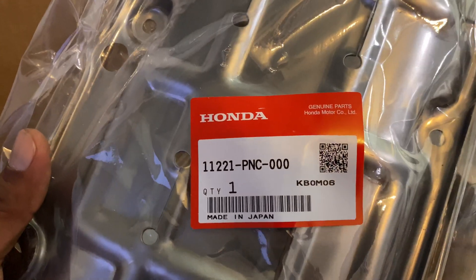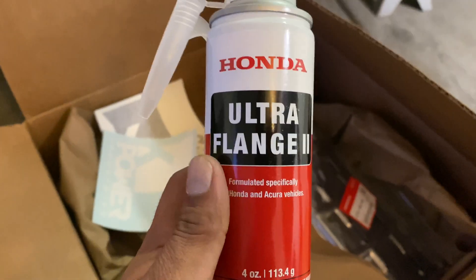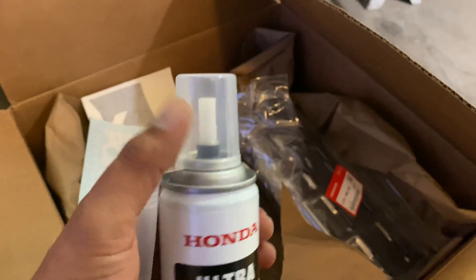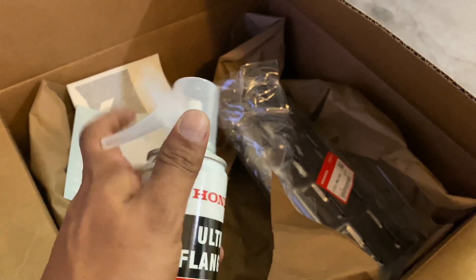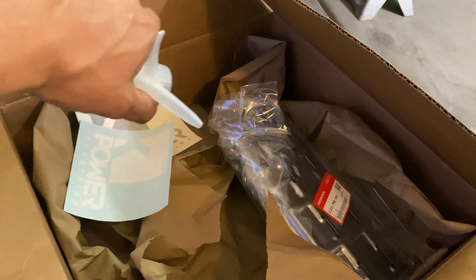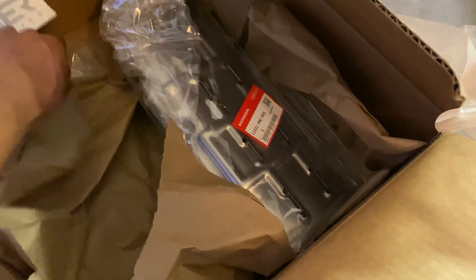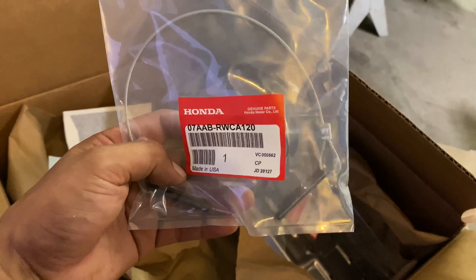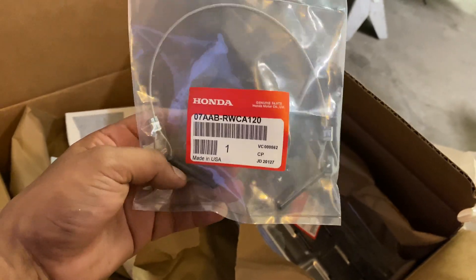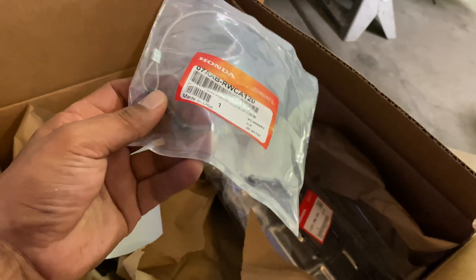We got our baffle — there's the part number. Then I got some Ultra Flange; this is Honda Bond in a can pretty much. When you press this in, it already comes pre-cut, you just put this on there and it leaves the trail right exactly where you want it — this thing works wonders. And then we have our cam locking tool. You're going to need this tool if you're going to do your cam gear and also for your timing. Here's the part number — very important tool. A lot of guys just use something of the same diameter, but you can't go wrong using an OEM Honda part.